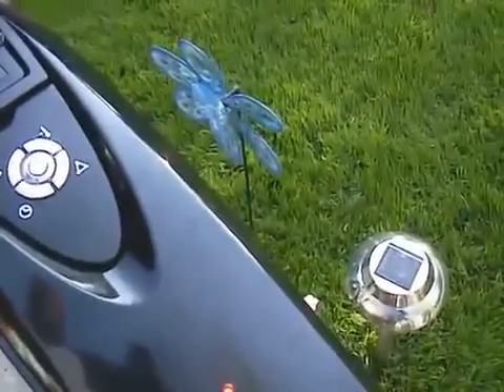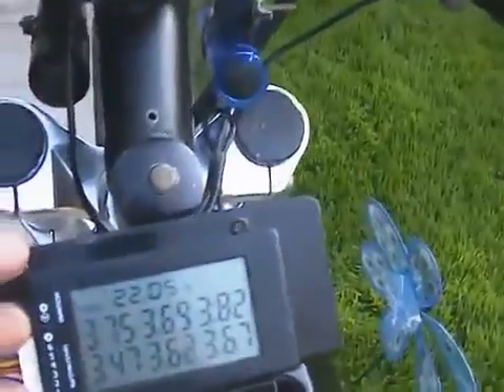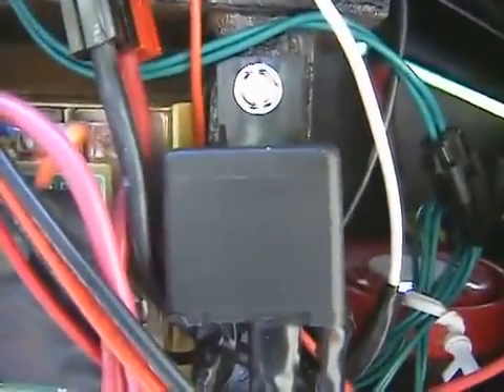I got this one tapered this way — they're actually built the same way, actually the wrong way, but it's still cool. Oh shoot, I left the bike on all this time — still pretty good, good use of charge. This is the relay — it's from Canadian Tire, rated for 40 amp, 12 volt, and it works. The only problem I had was a FET on the board — a smaller one that would overheat and turn off to save itself from destruction. I changed it with a more heavy-duty one and it doesn't even need a heatsink — it stays lukewarm.